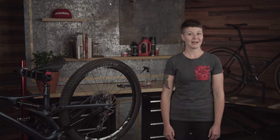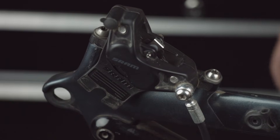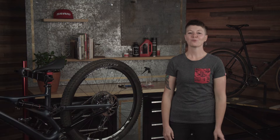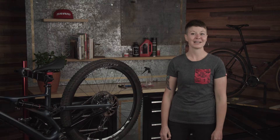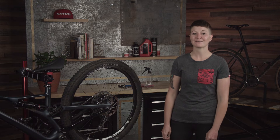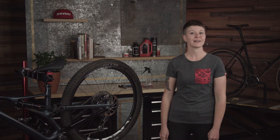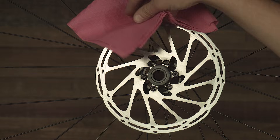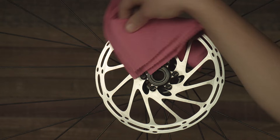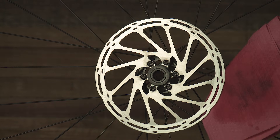To properly advance your new pads, flip over the pad spacer so that the thin end is installed between your brake pads. Lightly pull the brake lever until the contact point feels firm. Before installing your wheel, go ahead and clean your rotor using isopropyl alcohol. This can help minimize noise and prevent contamination of your new pads from any residue on the rotors. Spray a clean lint-free towel with isopropyl alcohol and wipe down both sides of the brake track on the rotor. Once cleaned, make sure not to let any oils, cleaners, or your skin contact the rotor surface.